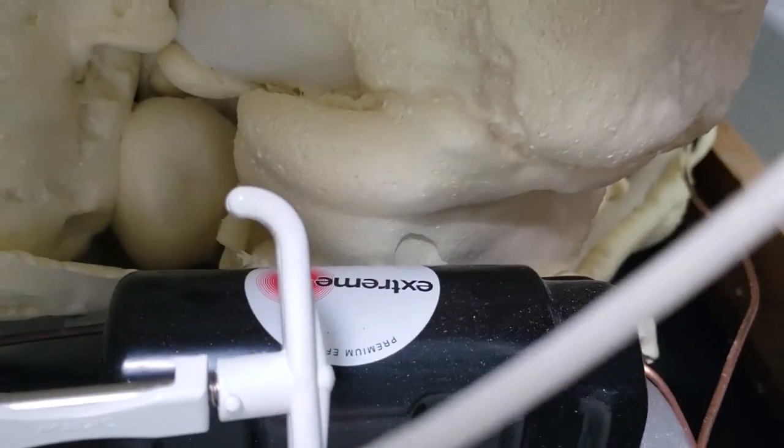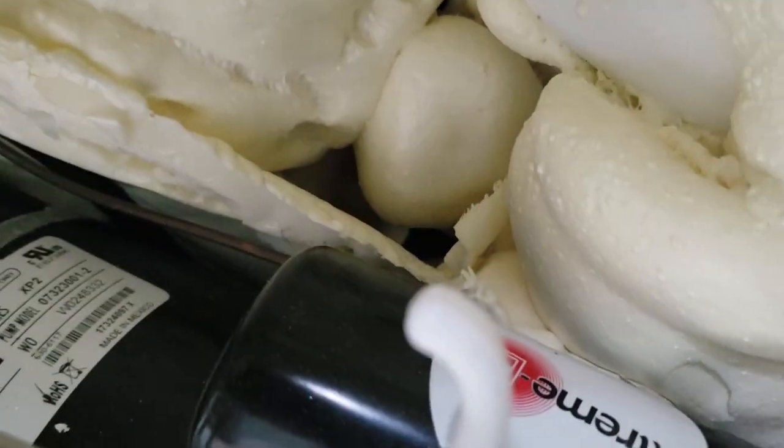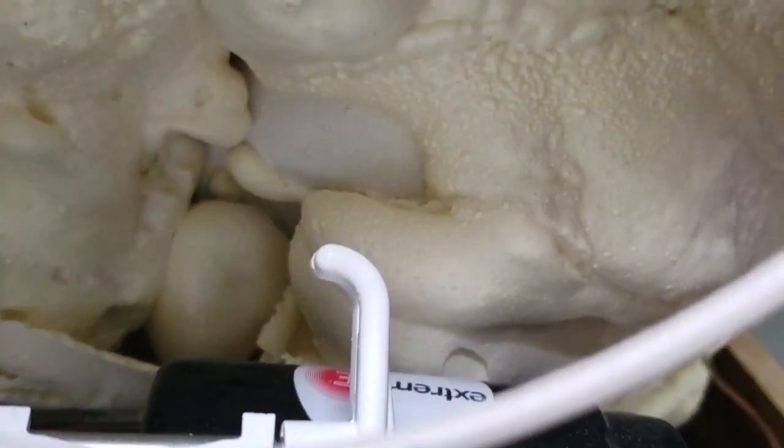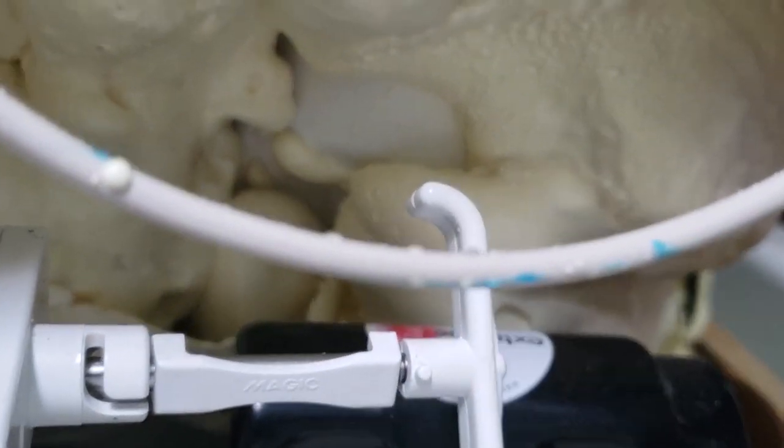But what I don't like is the carelessness with which it's been applied. Look at that motor — all that foam is literally right up against that motor. You look in this area here and it's literally up against the pump head and the motor. Man, that's just not good. That's going to cause a lot of issues with cooling. That motor is going to run hot, simple as that. There really should be a shroud here.